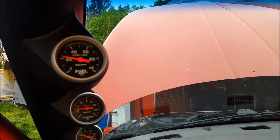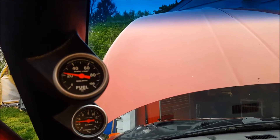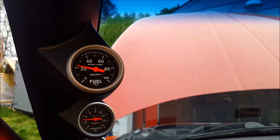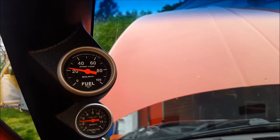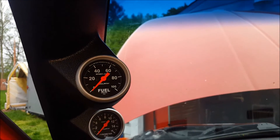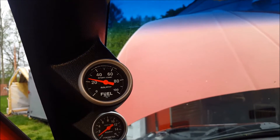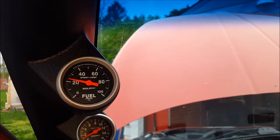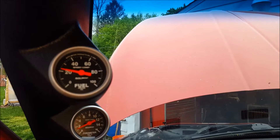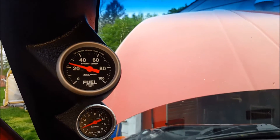With both those components replaced, I'm still having a problem with a very fluctuating needle. I understand it's a mechanical pump and some fluctuation is normal, but this seems excessive. The needle's kind of jumping all over the place, and it seems like after it warms up, it actually drops down to 10 PSI — bouncing between 10 and 30 all over the place.